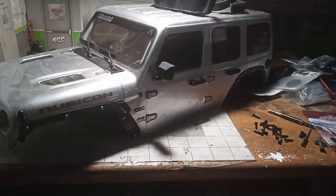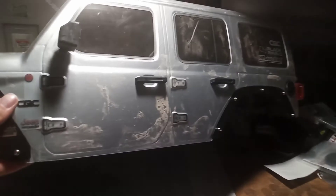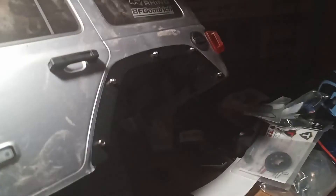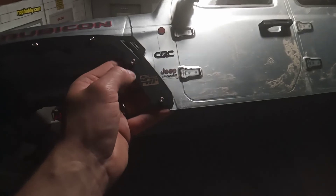Alright guys, once I get it on I'll show you. Alright, there it is with the flares on it — there's the old ones. I'll lean this up so you can see it. Looks pretty nice, pretty snazzy. Little fake vent there. There's the back. Some of these screws were different sizes, so keep that in mind. You do have to take the grill out — it's just these two screws on each side, four total. Those come out and then you can get to the last fender flare bolt, which is right there as you can see.